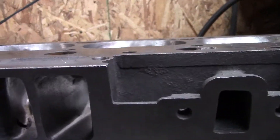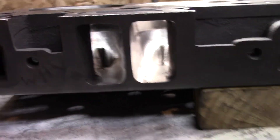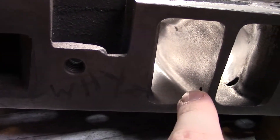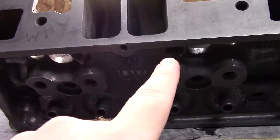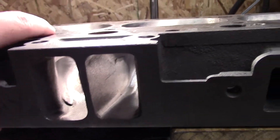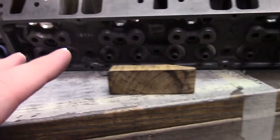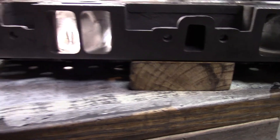Back to the other things I want to point out. What I wanted to point out is, right here, this is why most modern heads have a raised valve cover rail - because otherwise it's too shallow and you're going to break through pretty dang easy. You can see right there - it's not a big deal. I like using studs for my valve covers anyway, so I'm going to put some studs in there and put some good sealer in there and I'll be good. Just be aware of that. Use caution so you don't break through for your valve cover bolts or your head bolts. Just take your time. If you're in a hurry, you probably shouldn't be doing this work anyways, unless you're a pro who's been doing it forever.